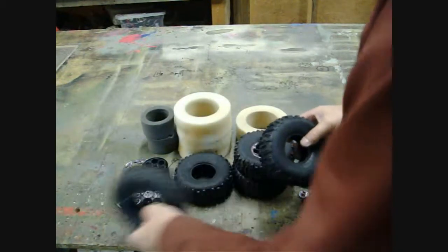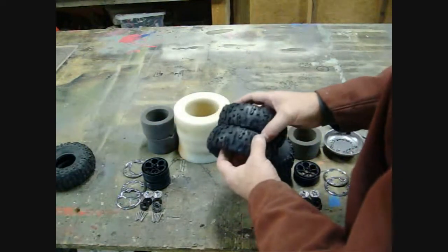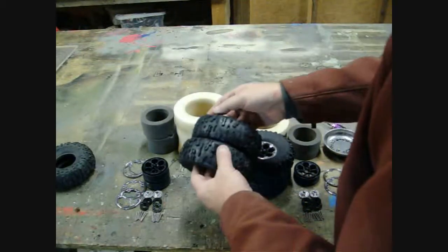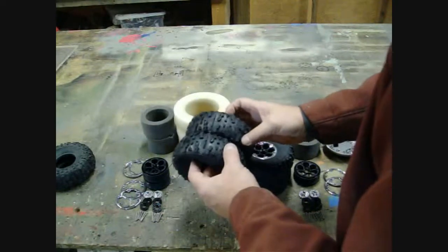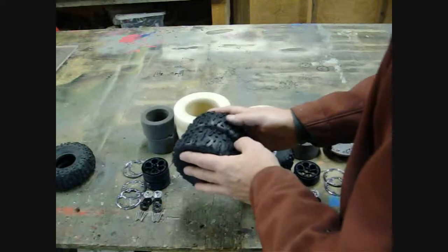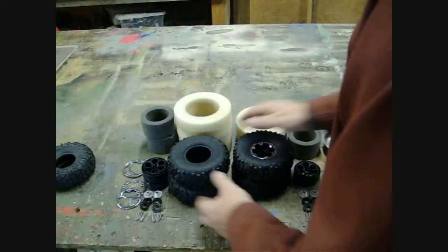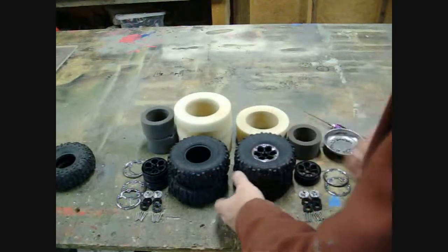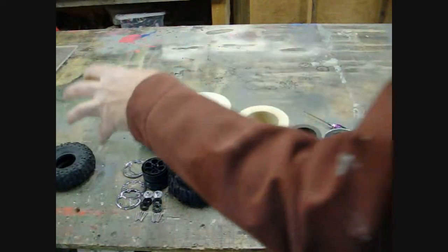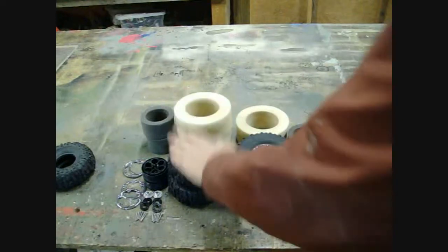Okay. You'll notice that these tires are oriented. They have tread that has an orientation, that would be opposite each other. Same. Okay, when you're mounting tires, you're going to be doing fronts and rears separately. You're going to want to pair them. Now, the way that you run your tread is entirely up to you. You have to test it, see what works best for you and your terrain. But you're definitely not going to want one way and one the other way. So, okay? That's tires.